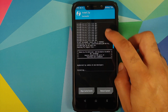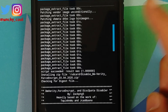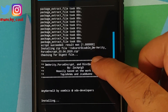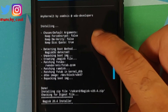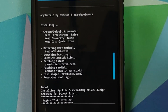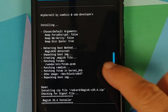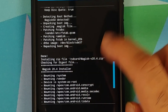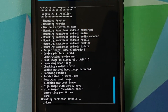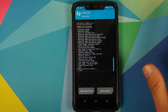Scroll up to verify the flash results. You can see the 'Script succeeded' message for MIUI 11.0.9.0. After that, Disable Force Encryption patches the fstab.qcom file in vendor/etc — patching fstab done. Then Magisk 20.4 installs as well. Everything looks absolutely fine.